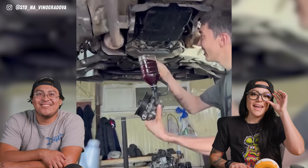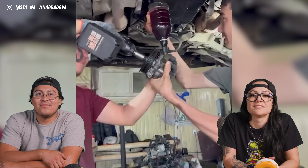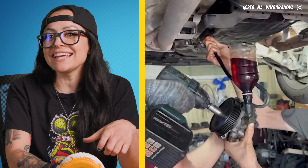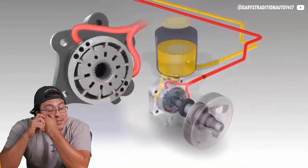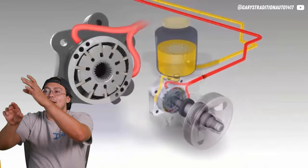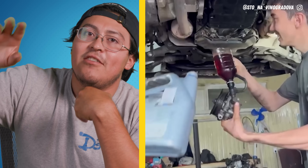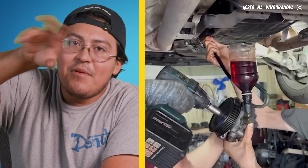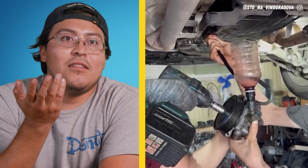Let's go to that next clip. I've seen this — I'll put it in a drill. A power steering pump basically works by having a little pump spun by the accessory belt that, as it spins, pulls fluid and squeezes it into a smaller space, pushing it out at fast speed. That's what they're using here as they're spinning it — it's grabbing fluid and pushing it into the transmission. So they're doing this to load up their transmission with fluid.